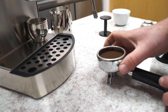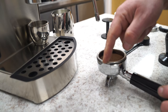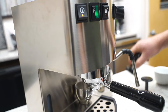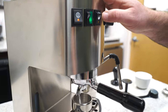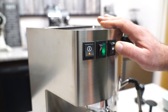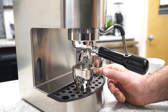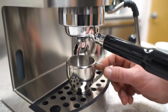The portafilter lips are in a one-and-seven position. Load it in — with proper tamping you'll have good space for the dispersion screen. Put the cup underneath and press the coffee switch. The machine's been warming up a good 20 minutes; 10 to 15 is probably sufficient but longer is better. The espresso should start coming out between five and seven seconds; it could go up to nine. That humming sound is the three-way solenoid valve — there's a lot of back pressure, meaning the grind is too fine.